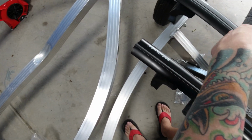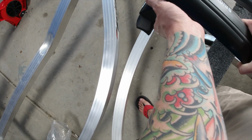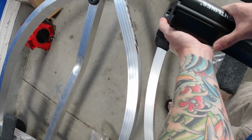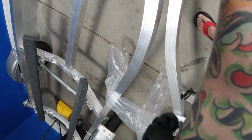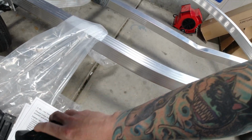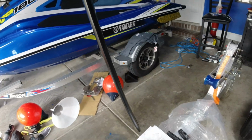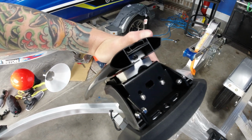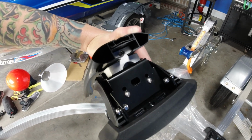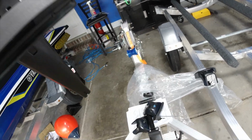A lot of times you film this stuff one-handed. I think I got it where you guys can see it. There's a key. It says to unlock it, so I think there's a lock on it. Let me grab the key, because the one I got out, I did without doing the lock. I loosened each end. The one side slides out really easy. On this one, I think what you want to do is leave the rail on, because then you slide the other one in when you're bolting it down. So what you want to start first installing is the ones where the rail is left on. You'll start on the driver's side on both of them, and then you can slip the other one in there to align it correctly how you want it.